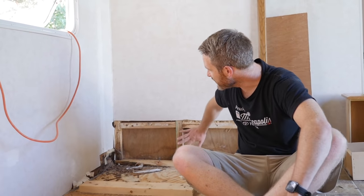As we were removing paneling on the slide-out to get to the water damage, we found more water damage. As it turns out, one of the knobs for the window on the slide-out was cracked on the inside, so the window wasn't closing all the way, causing water to come in — and as you'd expect, that caused more water damage within the wall. So we're removing that, and hopefully that's going to solve it for this slide-out. We still have the water damage in the bedroom to take care of, and hopefully we can solve that next week.